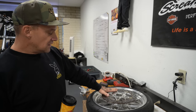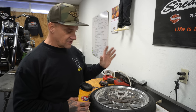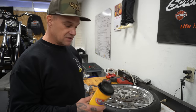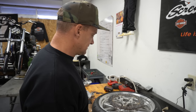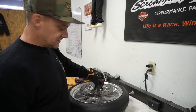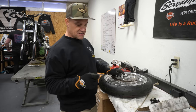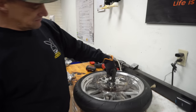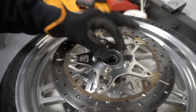The generic one works good if you're just doing this yourself in your garage, but if you're gonna do it professionally and use it regularly, it's not gonna last. For you guys at home, the Amazon Harley-Davidson bearing install and replacement tool is pretty dialed. I have a Jim's one because I started out with the Amazon one and it lasted not very long. These are 25 millimeter bearings — this is a late model bike, 2008 and up is 25 millimeter. You can tell by how thick the bearing is front to back. A 25 mil is very thin depth-wise. The one-inch bearing is twice as thick, and a three-quarter bearing has a lot smaller hole.